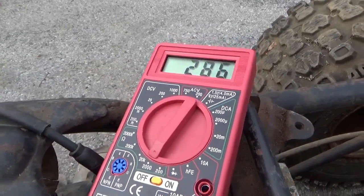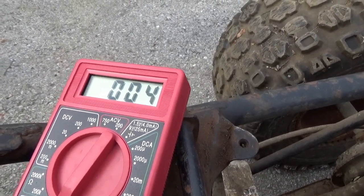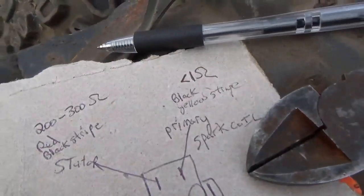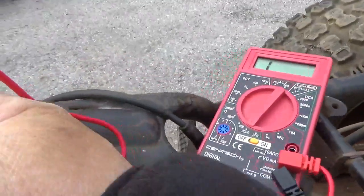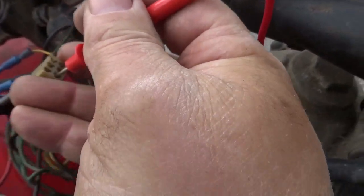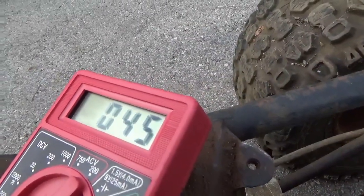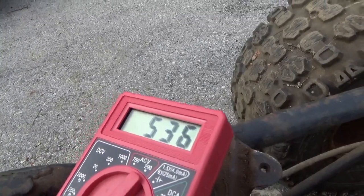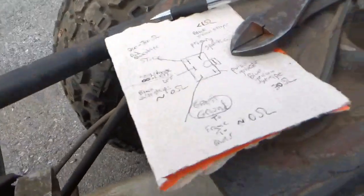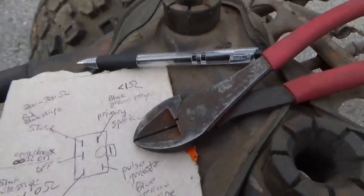The next one around is the input to the spark coil — if I work at it I get almost down to zero ohms, and it should be less than one ohm. Then there's a blank pin right there. The last one in the corner is blue and yellow — you should get between 20 and 40 ohms depending on how well you connect and what range you're on. I'm seeing 32 to 33 ohms, so I wrote down around 30 ohms. Sorry for the slightly shaky camera work.